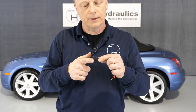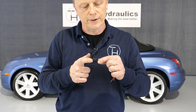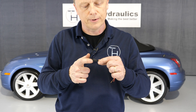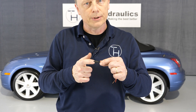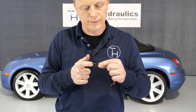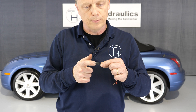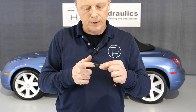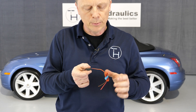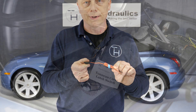Pretty cool. These are solid state sensors that don't normally fail. However, they can fail — it's rare. They are safer than microswitches, but they can fail. Fortunately, Top Hydraulics was able to secure a large lot of these sensors, and we do sell them to the public. You cannot buy them from Chrysler or Mercedes or other companies separately. But when we have them, you can simply splice them into your wiring harness and make the whole thing work again.